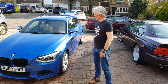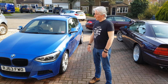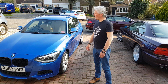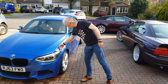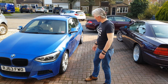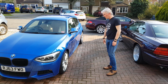So yeah, I'm very pleased with that. It's got a good shine on it. It looks nice. It looks much more sorted than it was, because I hate these sort of marks on the side. So yeah, that's exactly what I did on the E31. Do all the surfaces with the rotary polisher, and then start using Zaino on it, because the Zaino 2 is just hard as nails. Once you've got it on there, you get very little damage to the paintwork after that, because it really is tough. So I can see from here there is sun reflecting in it, no sort of holograms or anything, and that's what you expect after a machine polisher. A machine polish, it does really look great.